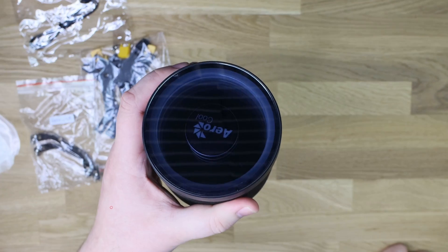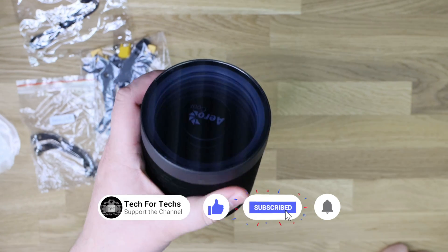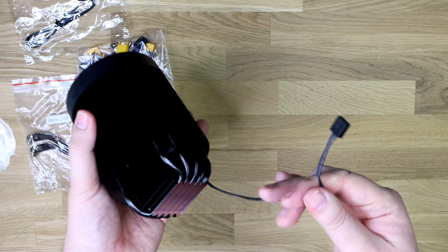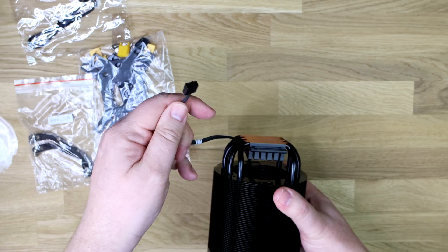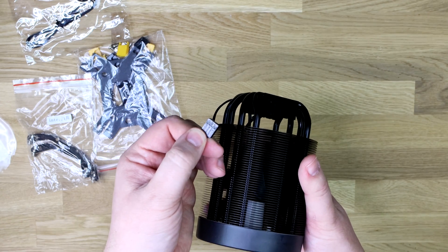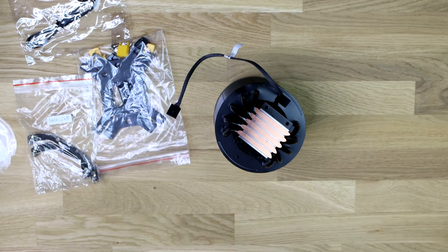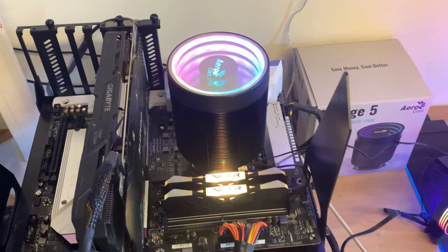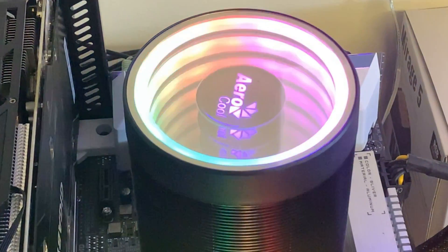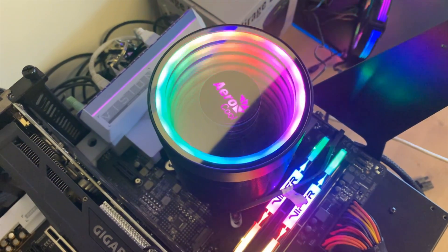Using mirrors isn't the highest-tech approach, but it can be quite effective if the lighting is done right — and looking at the box art it seems like they've got that right. The cable you plug into your fan header is a four-pin PWM connector, which allows the motherboard to adjust the fan speed depending on how hard the CPU is working. For example, if the CPU gets very hot it'll spin the fan faster, though that will produce a little more noise. We'll do full testing shortly.